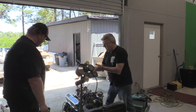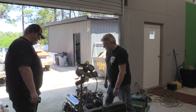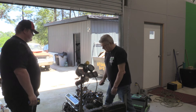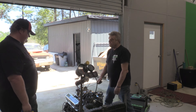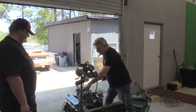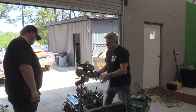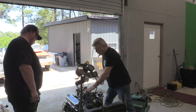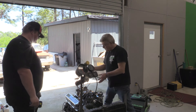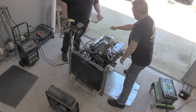We lost the fuel pump again because we're running off a wire. I'm ready to pop it off into the engine bay as it sits. This is in good enough shape right now — we've got plenty of oil pressure on the inside of the engine. All this carburetor tuning I would rather do with a full exhaust system on it the way it's going to run. But you'll want to adjust those mixture screws on the side of a Holley — they're really key to better performance at idle. Right now we don't have any exhaust on it so it's running straight out of the manifolds. I'm seeing a little bit richer run on the driver's side than on the passenger side.